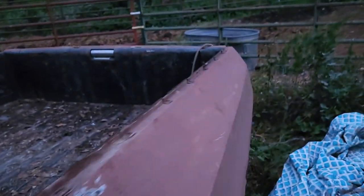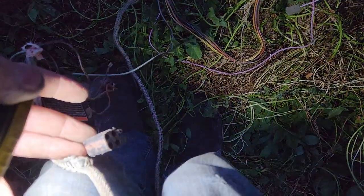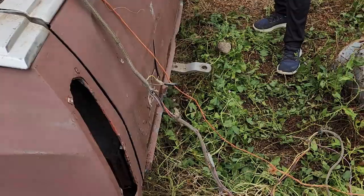So if you look, there's room back in there for you to run your wiring. Your wiring out here actually has a wear sleeve on it and actually has a fitting there for under the dash. You have all your other pieces where it comes down to here. If I can get my light to it, there's a connector right there - that connector connects to that connector. These are your driver's side tail lights.